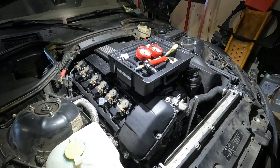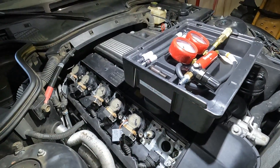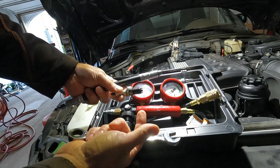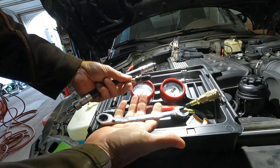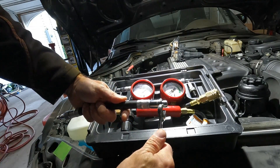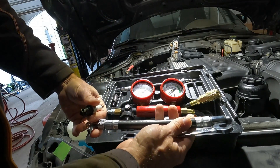There are a couple of things you need to prepare for a cylinder leakage test: access to the central bolt and removing the plugs and coils. This is a BMW Z3 with an M54 engine, but this applies to any engine. Most kits come with multiple adapters. To find the right one, take your spark plug and a wrench — find the right size. A 14mm wrench that fits over the spark plug means you need the 14mm adapter. Then compare the threads to confirm they match.